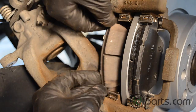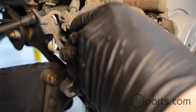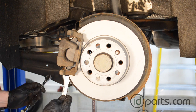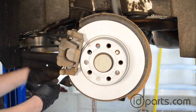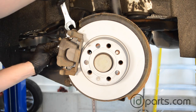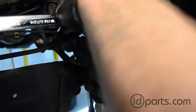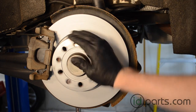Once that's on, we just need to slide our brake pads right in — they slide in kind of front to back. We'll be sure they're flush against the rear before we try to put the caliper on. Then we'll slide the caliper in place and take the two caliper-to-carrier bolts, which come with most new brake pads. Those are the first bolts we removed when we did the brakes. Once those are tightened down and everything is in place, we'll double check to be sure everything's aligned. The final check before getting in the car is to spin the rotor to be sure the pads are not dragging.